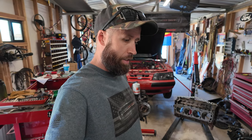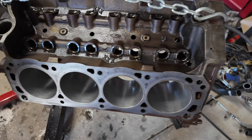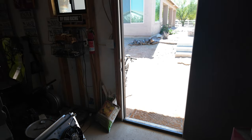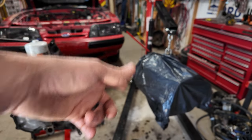Okay, so we're all ready now. This guy is ready to come apart — we can throw everything into this one. This one is cleaned up: cylinders are honed, sprayed down with the pressure washer, cleaned with degreaser, then immediately hit with WD-40, wiped down all the cylinders to make sure there was no water left. All the cylinders look good, got a nice crosshatch in them, and this thing is ready to go back together. We'll cover it up to keep the dust out.